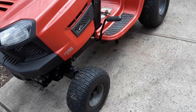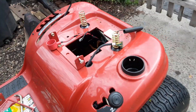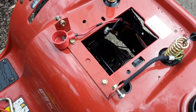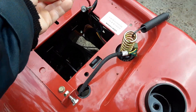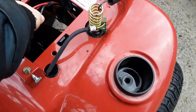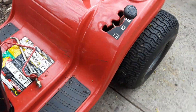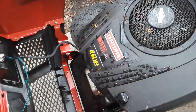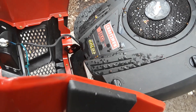Now I'm skeptical about everything else he did with this. Even the battery that came with it — he over-tightened it and broke one of the leads off. Luckily there's still enough of it left where I can take two fat washers and squish it on there so it stays. He tried very unsuccessfully and caused more problems than good. The fact that this thing's camshaft went bad at only three and a half years old is very sad.